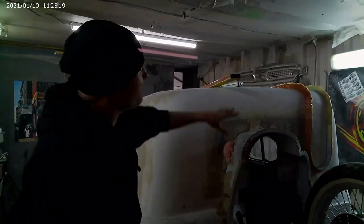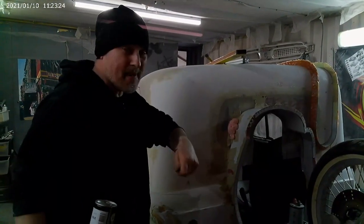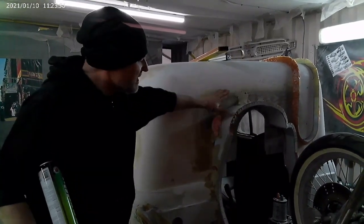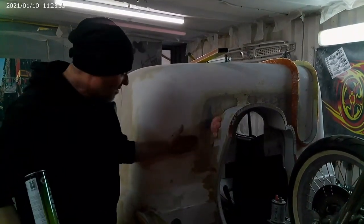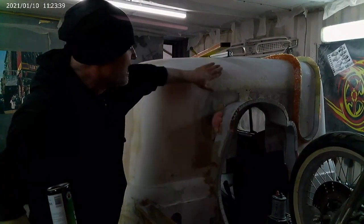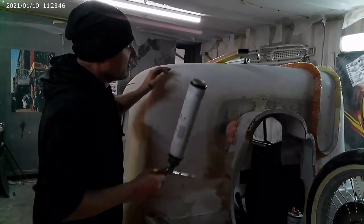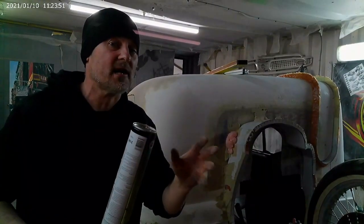Right, so on the other side, around the window, I've put a load of glass fibre, just like the P40 stuff that you mix up, so it's not super strong yet, but it will be. On this side, we'll be fiberglass in this end, so this is probably strong enough, but now what I need to do is build up an amount of foam so that this all flares into the body. So I'm going to do that with some foam, put it on nice and slowly, and we should be able to get close to that with foam, but then sculpt it to shape tomorrow.